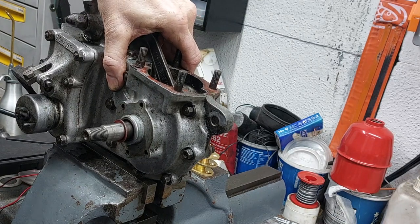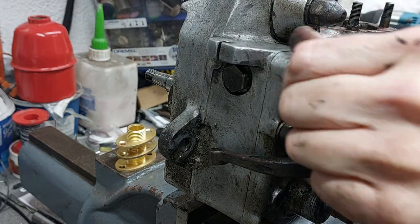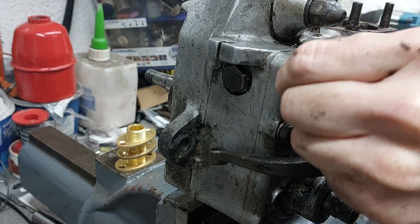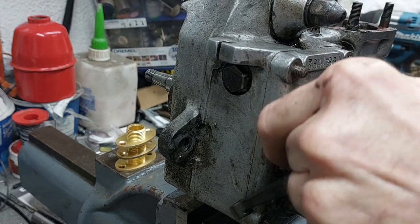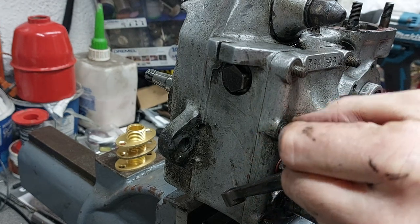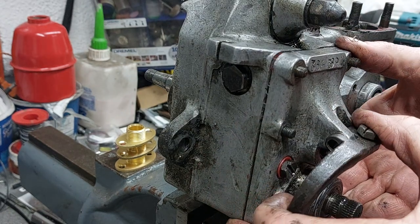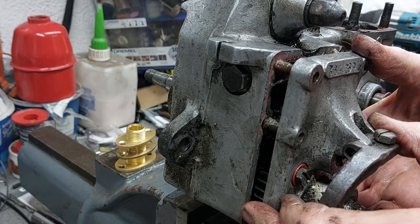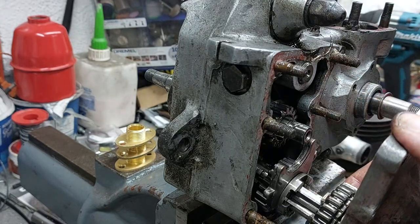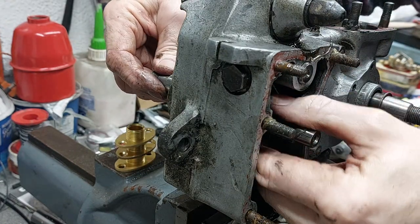And then we flip the engine round the other way so I could gain access to the gearbox. That's secured with six nuts. Just remove the six nuts, and then the gearbox withdraws out of the crankcases, just like that.